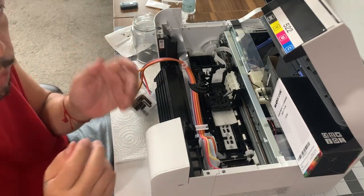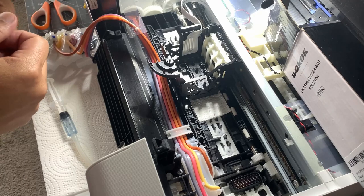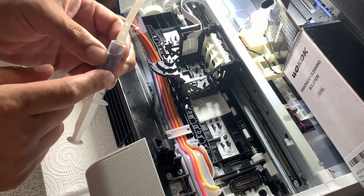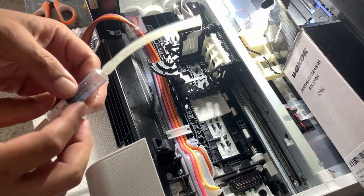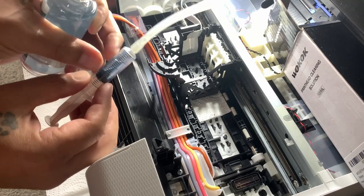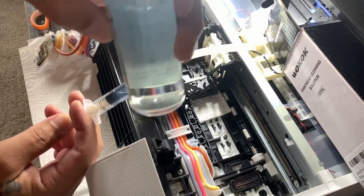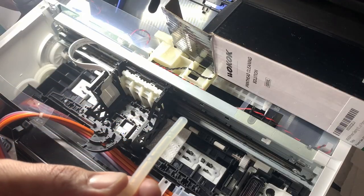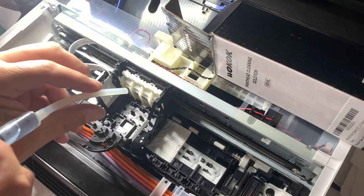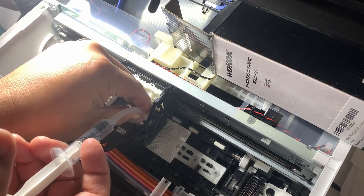I cleaned all of them out and poured some back to make sure all the dampers were full. I did fill up a little bit of the syringe with the liquid. If you're using the little tip that comes with the kit, hold on to it — because of my arthritis, when I pull back it tends to want to push back in, and I cross-contaminated the clear liquid a little bit. Now I'm gonna make sure the air stays up top, then put it over the cyan channel, going easy so I don't damage the printhead.